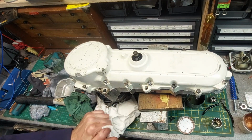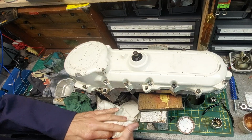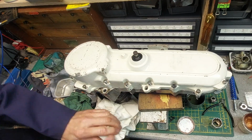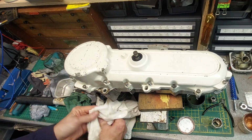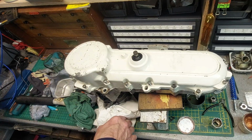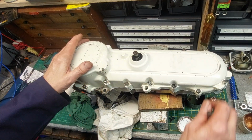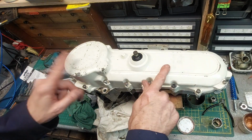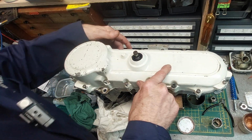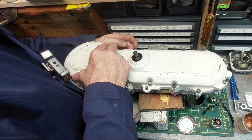Okay, and because they were tight coming out, I suspect they were torqued down, and the manual says M6 screws, 6.5 to 8 foot-pounds. Right, see if I can rig something up to use these bits on a torque wrench. What's that, Jenkins? Yeah, he's quite right. I should really check that the release action and everything works before doing it up tight.